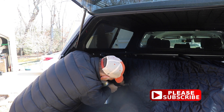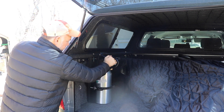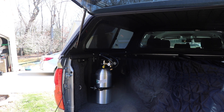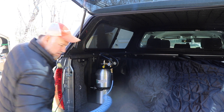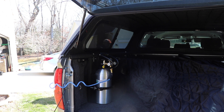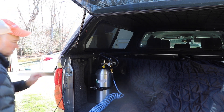The tank fits good — it doesn't stick up too high. This is a 10-pound CO2 tank. I'll use it about 80% of the time for power tools like nail guns and grinders. It doesn't take up too much room at all — it comes out about as far as the wheel tub. This is a great addition to the truck. I just wanted to show you how you can make these brackets out of 8020 to hold things inside the bed of your pickup truck. This will also work in vans — you just have to think it through and sketch it out.